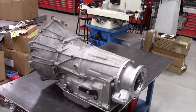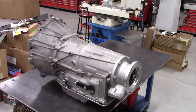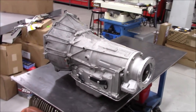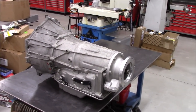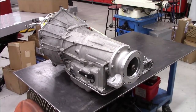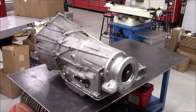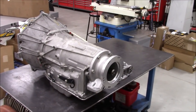This transmission has a 4.02 first gear and two overdrives ending in 0.667 — so it's about 34% overdriven. Combined with my 4.56 gears, that ought to make this thing pretty snappy around the streets. When I go into four-low, I'm going back to a 2.72-to-one transfer case, so I'll still have roughly 11-to-one first gear in four-low — similar to what I have now with the 2.8 42RLE and the 241OR transfer case.